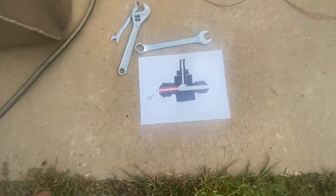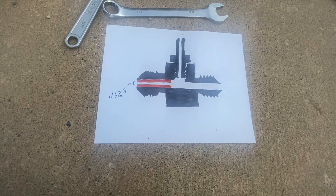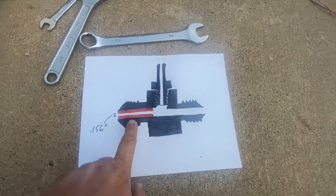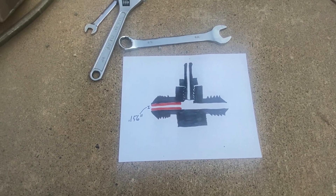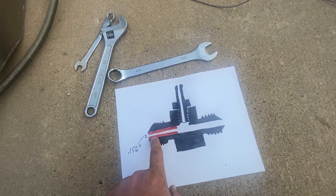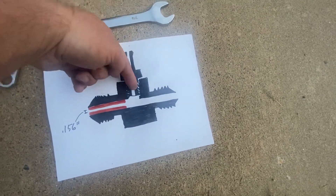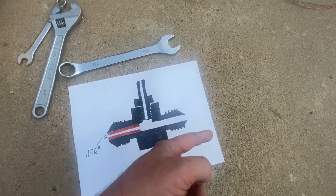The way this works — this is kind of what I built — is just a 6AN gauge adapter fitting with a hose barb screwed into the gauge adapter port. The high velocity fuel coming out of the jet creates a low pressure zone due to the Venturi effect and sucks fuel into this port and out. You end up with more fuel going out the outlet than what you have coming in the inlet.